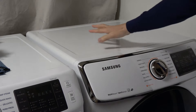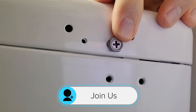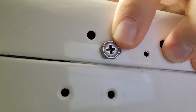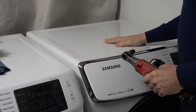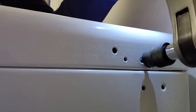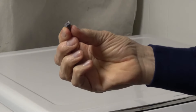Then we'll need to remove the top lid. On the back of the unit, there are two screws. You can use a number two Phillips or a 10 millimeter nut driver. You could also use a socket wrench with a 10 millimeter tool. I happen to have an electric driver for that function, and so I will use that — it just makes removal really fast.